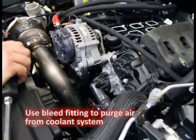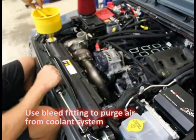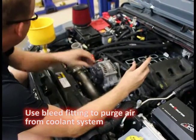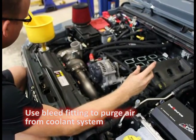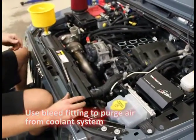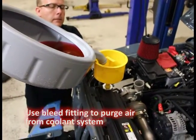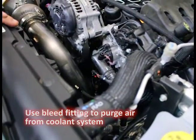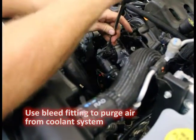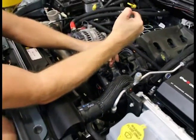Let the coolant flow and you can hear the air rushing right out of it. It drank all of that so we're going to put some more in and do it again. That's it - that's all you need right there. At that point just close it off. I've got another pan down at the bottom catching this, but get it down and just tighten.